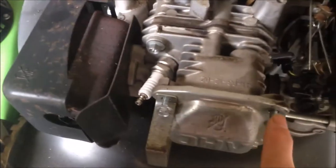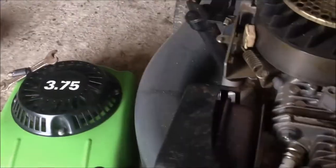This is the performance lawnmower from B&Q. I have removed this case, and we have the bolt here and a bolt here, so we have some over there, and that can be removed. And then the two bolts from here and here for fixing this coil.